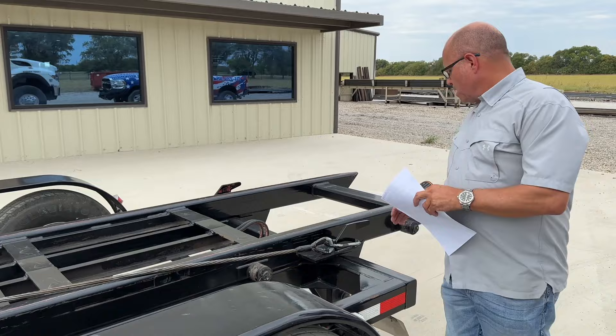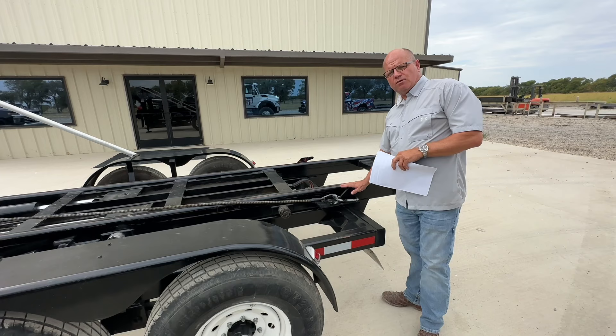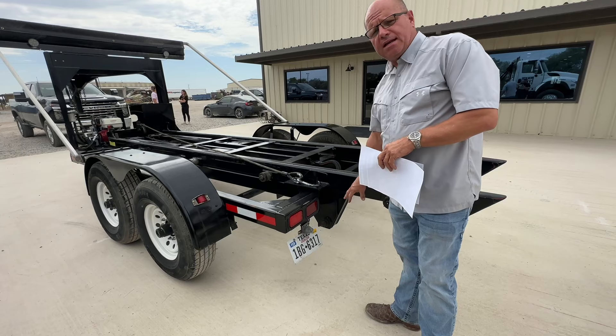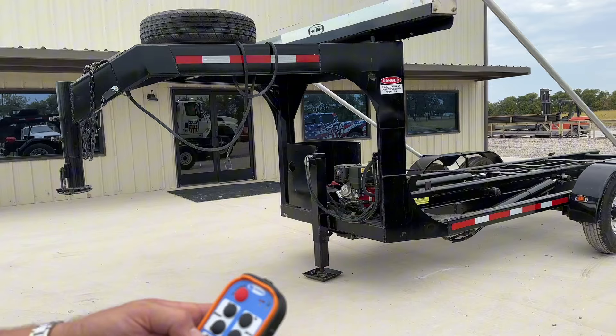Then you've got the rear hold-down system. The rear hold-downs on this trailer are set to industry standard — not a proprietary location — so anybody that knows ANSI standards should be able to build a can to directly fit on this trailer without many questions at all. And then last, you've got the rear pivot point assembly: inch-and-a-half pin. I see some out there a lot thinner in diameter than that inch-and-a-half pin. Again, greasable for longevity. LED lights in the back, backup alarm, and license plate light.